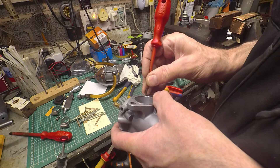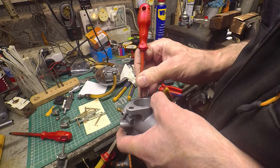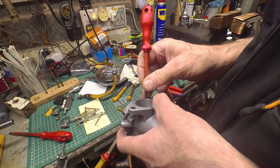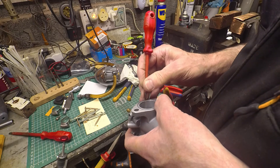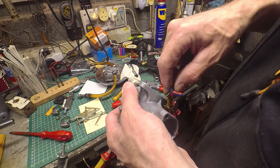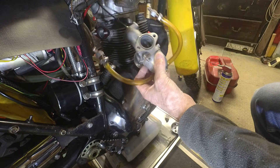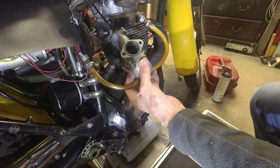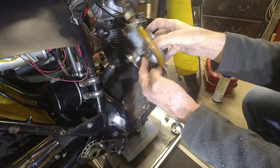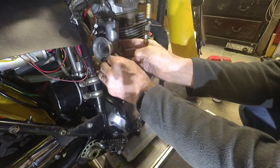Something that's become apparent as soon as I tried the O-ring in the slot is that it needs deburring. There's a burr on the outer edge and the inner edge, but just running a screwdriver around seems to be doing the job. The inner edge here has also got a slight burr on it. With the carb back together, the throttle slides beautifully just as it did before. The question is whether it's going to stay like that when it's clamped up, so I'll whip it back onto the head and hope for the best.